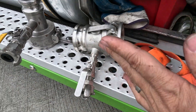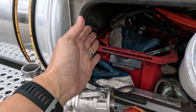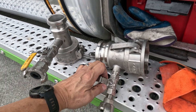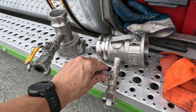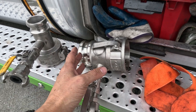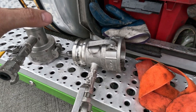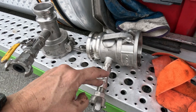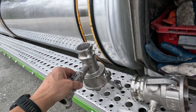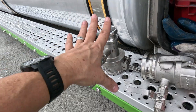Once you clear the line, close this valve. Now if you're unloading into a tank that drops down into the top, if you're in a bottom-feed tank, you've got to close their line first — that way the product doesn't back up. Then you close yours, disconnect, and then you'll open this and bleed the air pressure off. If you're unloading to the top of a tank — where the product goes in, goes up, and dumps down into the top so it's constantly vented — as soon as you close your valves and close your air, there's going to be no pressure built up. But if you're unloading into the bottom of a tank, there's going to be that pressure. So you'll have to disconnect your air, open this valve, and that bleeds any pressure that's in that hose. You don't want any pressure in that hose because if you go to take the ears off and take that hose off, it's going to pop off — it'll kick you back. So that's why it's always important to have a fitting with a bleed-off. This is for a two-inch hose — so if you've got a three-inch connection on your trailer and a two-inch hose, same thing, you've got a bleed-off so you can always open this and vent any pressure in that line before you disconnect.